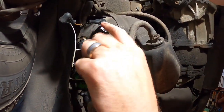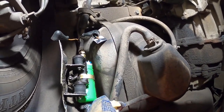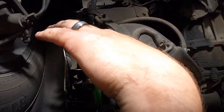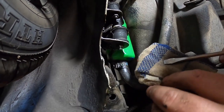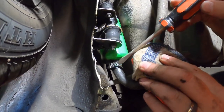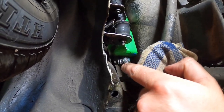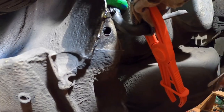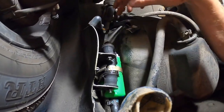We got the two electrical connectors off. Looking from underneath the car: eight millimeter, seven millimeter — just loosen them up with the socket, untwist them by hand, and move the connectors aside. There's no power to this car, but I'm always cautious so I put electrical tape over them just in case. The next thing we're going to do is take this side of the fuel line off — there's a connector with a screw, so we'll loosen that up and this hose will just pull out. Make sure you have a fuel line clamp on; it's still going to be a little messy.